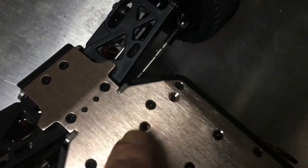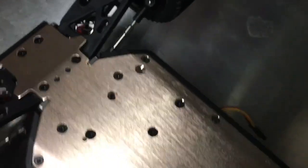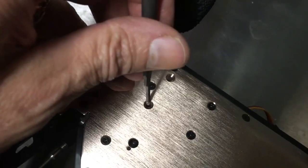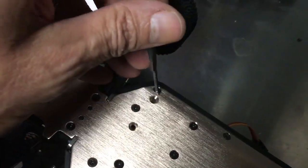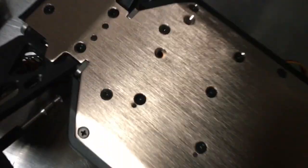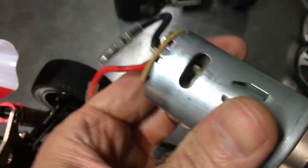Yesterday I talked about it and I managed to use a punch — basically nail these guys with a hammer, make an indentation, and then unscrew them. Luckily they weren't too bad and I didn't have to drill them out, because I was really concerned about messing up the body here of the chassis.